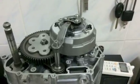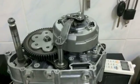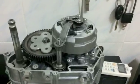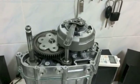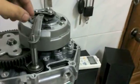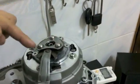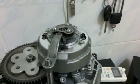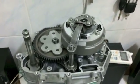Well, you have a few options. You can actually lean your bike completely on its side. You can do it, just try not to scratch it up. It will not ruin anything. I do it all the time. But if for some reason you're just completely afraid of ruining your bike or scratching it or leaning it on its side, you can get some really tacky grease. When you put it together, especially this triangle ball thing, you can put it on the end of the ball and glue it down somewhat when you're assembling it, and the grease will hold it, and that does work. But as I said, don't worry about tipping the bike on its side. It's just fine. It's not going to ruin anything.